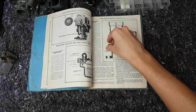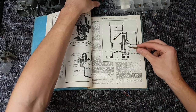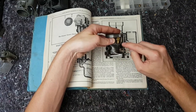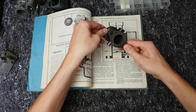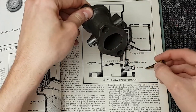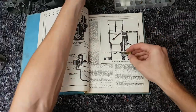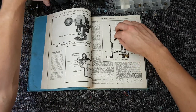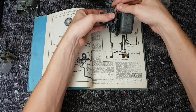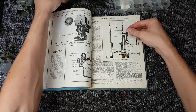We've got our low-speed jet and our idle adjustment screw. In the WO they're slightly different — the idle adjustment screw comes down at an angle, and the idle passage plug is here where the copper rivet goes. There's the idle port slot and the idle adjustment screw port. That's what we're looking at with the base. On the top it's exactly the same, however on the WO instead of the low-speed jet pointing up, it actually comes down and screws in — but it's identical.